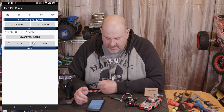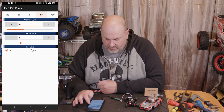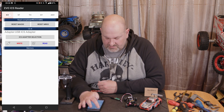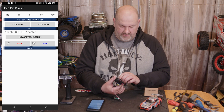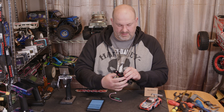We'll turn it off, plug the cable back in, power up, click Read — it reads again. At the top you've got Reset, which resets to your stock settings for the MR03 or MA03. I want to turn the LiFe battery LVC back off, so we go to that and Write — 'Write Complete'. Then power it off and disconnect the cable.